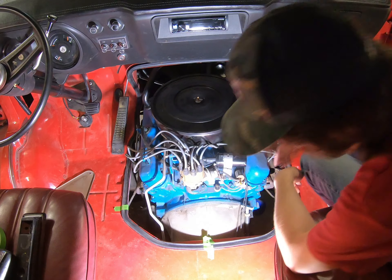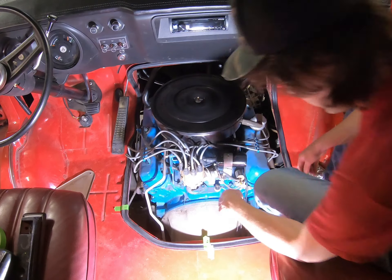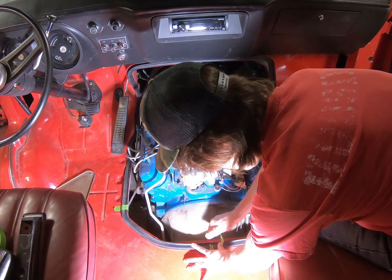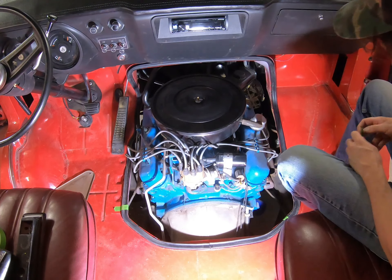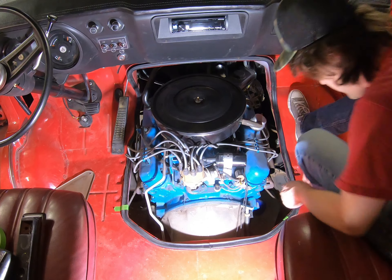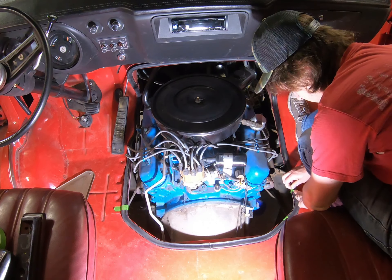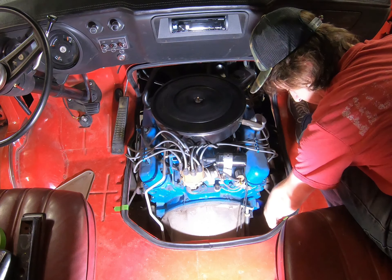So you saw me put some tape on here. That's to help control it mainly around the corners where it's wanting to pull up - just a natural thing. Don't leave the tape on there too long or it'll pull the skin off of the weatherstrip, especially if you have a tape that's really too sticky.